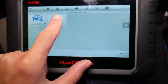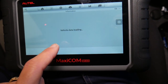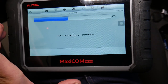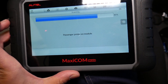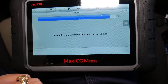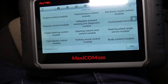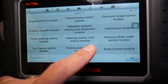I'm going to select the 2015 passenger car Chevy Cruze. It's going to load and ask which engine we have, then load the menus. Through the live data we'll be able to see if the fuel pump is activated or not, and we're going to check the fuel pressure sensor as well. That's how we diagnose them — and that way you don't need to mess with the fuel line, risk catching yourself on fire, or spray fuel anywhere.